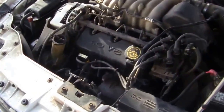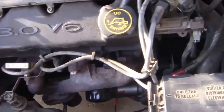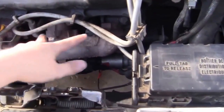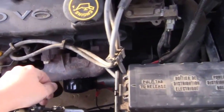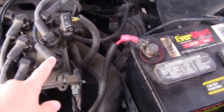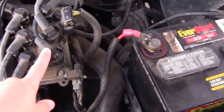I put my handy dandy spark plug tester in, undid the spark plug from that one right there, and there was no spark. So I did it on the other side and there was still no spark. So I had pretty good confirmation it was going to be in the spark somewhere on the ignition.